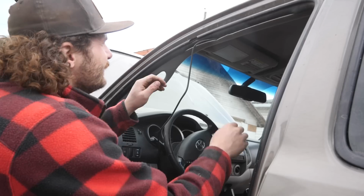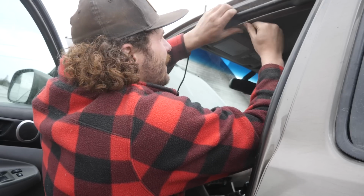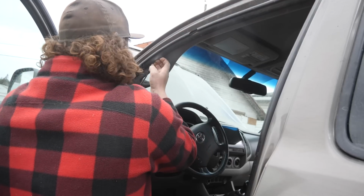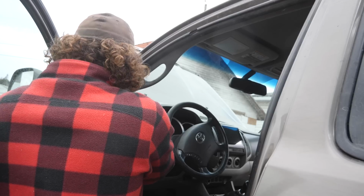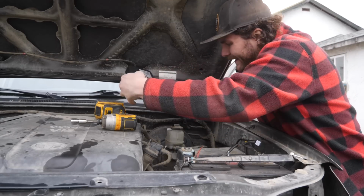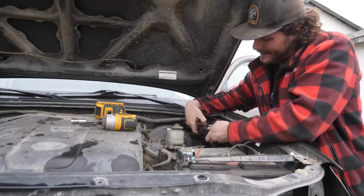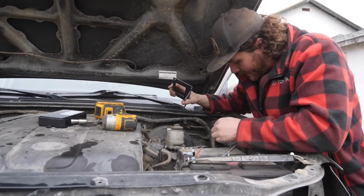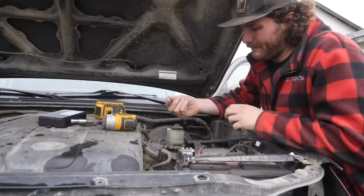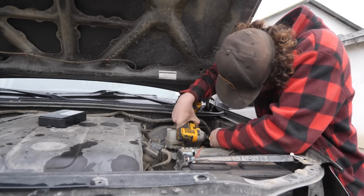That'll work great. Now, in theory, I kind of want to just tuck this in. Move back over. As far as fuse box mounting goes, I give you this nice L bracket that this guy attaches to, and then you can attach this pretty much anywhere on your inner fender, right? I usually try to aim for a factory hole somewhere, but on this Tacoma, nothing really lines up with where I want it to be. Big old self-tappers, and I'll just hold it in place and send these through.